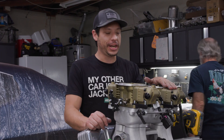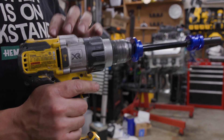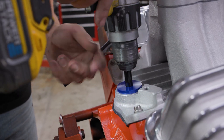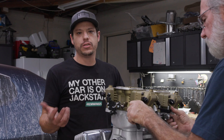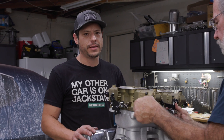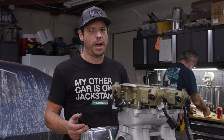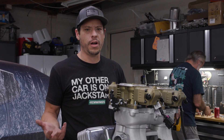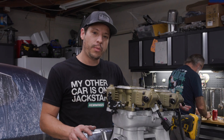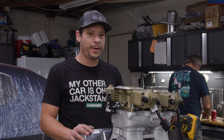Mike is finishing up the linkage. I've got the drill with the Summit Racing priming tool inside the SBC block. Been spinning that for a little while until we felt resistance and started seeing oil come out of all the right places. It's such a good thing to do on a fresh motor — otherwise you sit there cranking on the starter, getting it hot, and things aren't lubricated. It introduces a lot of wear early on that just doesn't need to happen. So we've got our priming tool, we've got oil pressure — one more step towards being ready for the dyno.